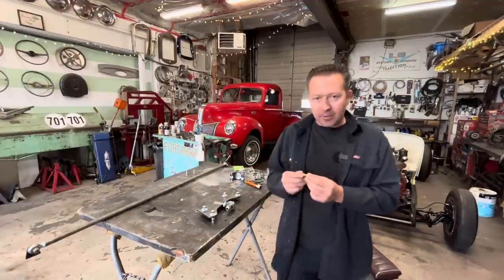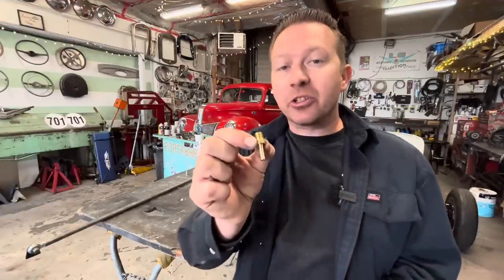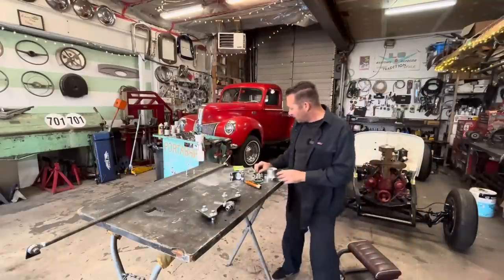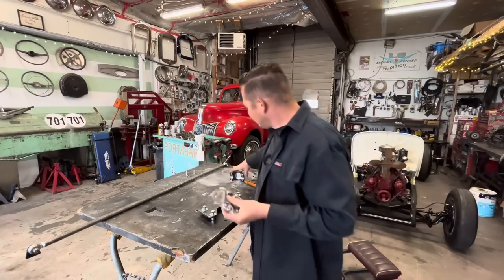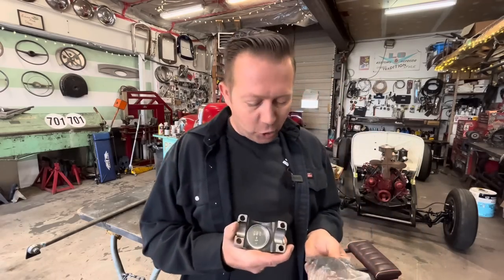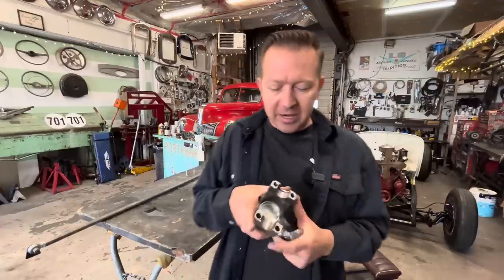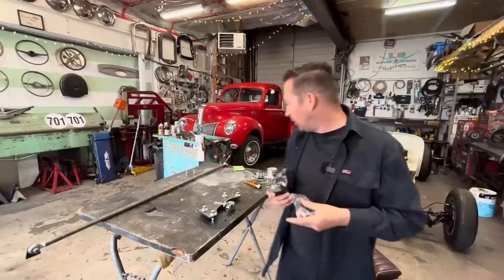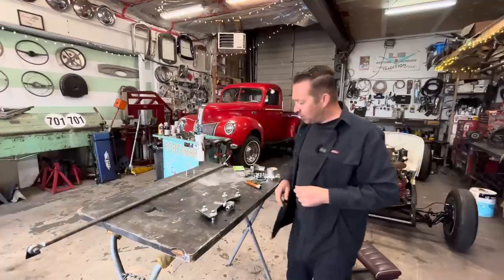And it also comes with a little vent tube. We're gonna have to drill and tap one of the axle tubes to accept a vent. So that's part one of the kit. Oh, and it comes with U-bolts as well. And this takes a 1350 U-joint, which seems excessive because I'm pretty sure that a Banjo rear end will definitely explode way before a 1350 U-joint would. But that's what it comes with, so that's what we'll use.